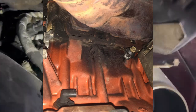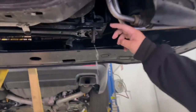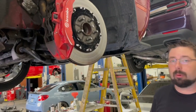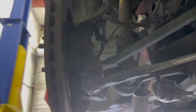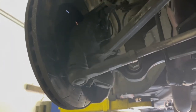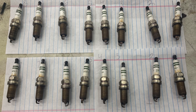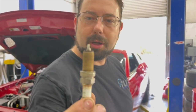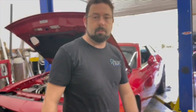Back at the shop — you can see the header gasket was bad, with black soot everywhere, but it's been replaced with new gaskets. The radiator blew out from the end tank during the burnout — we're replacing it with a metal radiator. There's a crazy wear pattern on the front of the rotor, but looking at the back you can confirm it's a factory rotor, not an aftermarket one. The wear difference from inside to outside tells us the caliper is applying more pressure to one side. We pulled the plugs — looks like factory OEM, replaced before, and the factory tune is running a bit hot but overall looks good. Compression was perfect: 200 PSI in all cylinders, plus or minus five percent — even with 175,000 miles.